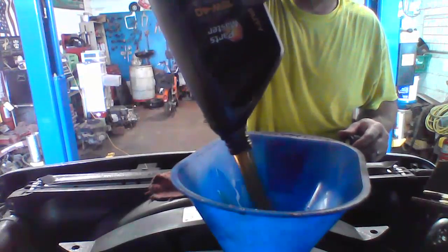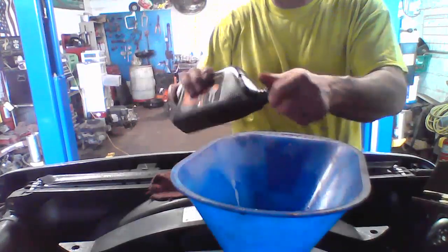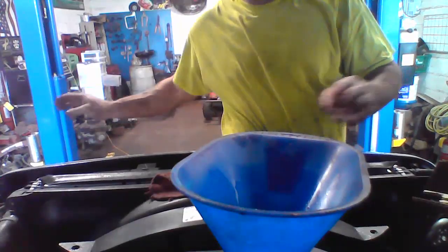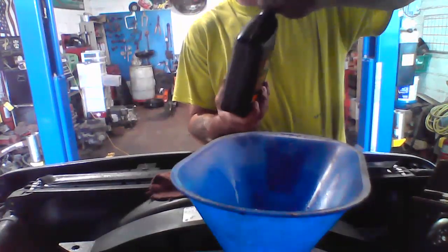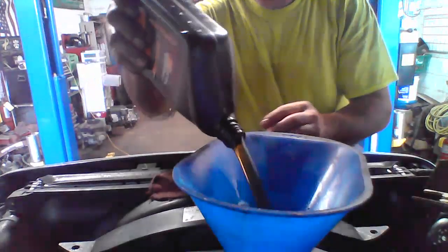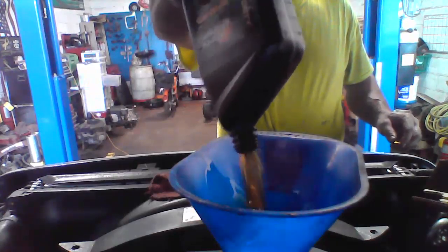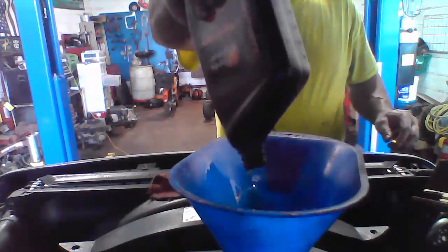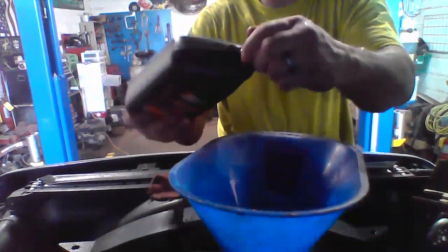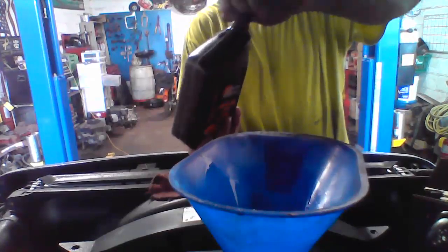After this, we're going to do the fuel filters. There are two locations on here. One's next to the engine, and the other one's next to the fuel tank. Usually like to do one thing at a time. Do the easy stuff first because next one I'm dealing with diesel fuel, and just the smell of diesel, you know, it stays on you.